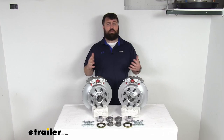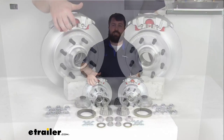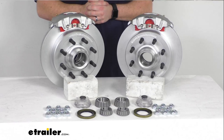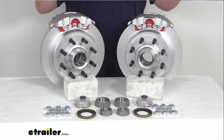If you are switching from drum brakes to disc brakes, you are going to notice a vast improvement in brake performance. Disc brakes are going to dramatically shorten your stopping distance. We've got ceramic brake pads here that provide increased stopping power, and a 2.5 inch diameter stainless steel piston that provides a fast, responsive braking experience — smoother, more controlled braking that helps keep your trailer from pushing and pulling like you often experience with drum brakes.